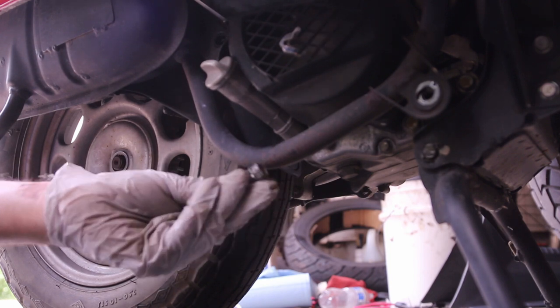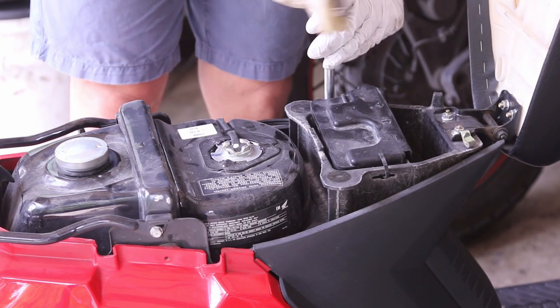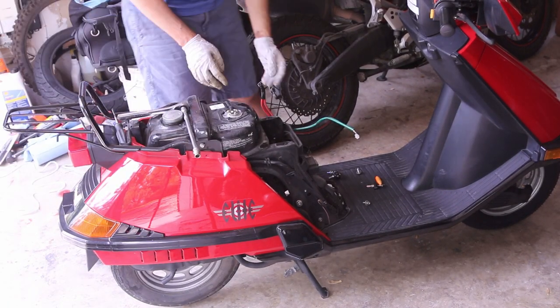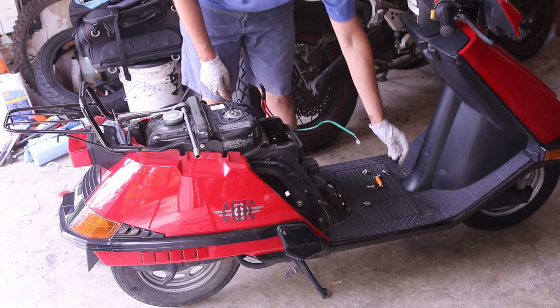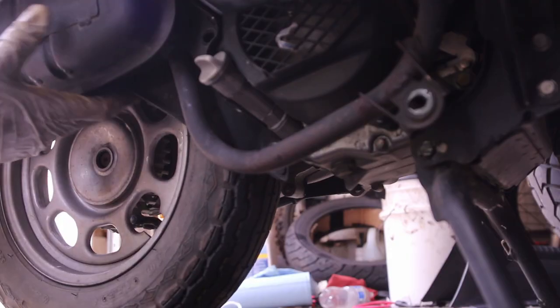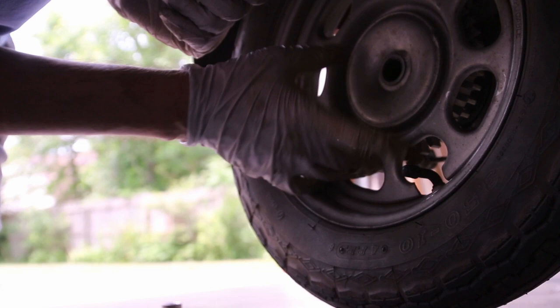There we go — this one popped right out. It's the same sort of style, it's got a metal spacer. After you remove the seat and everything and the battery holder, the front just kind of pops out — there are no bolts holding it. We should be able to reach using an extension and get those 10 millimeter bolts that hold the exhaust. They made such a terrible design here. Just by holding the exhaust and removing the hugger side, I was able to squeeze the tire out — tire's off.